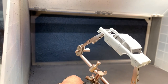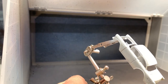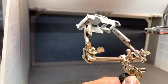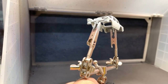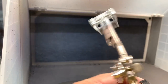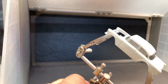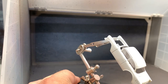Here we're going to put down the second layer of coats — now we can put them down a little bit heavier. Make sure you get all the hard to reach areas like inside the fender wells, inside where the engine sits, etc., to get good complete coverage. Make sure that when you're spraying back and forth you're covering the entire body — sweep the entire length of the body so the paint goes on evenly. This will help you get a nice smooth even coat.